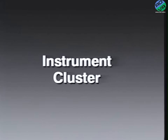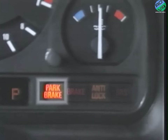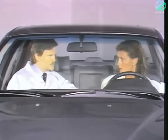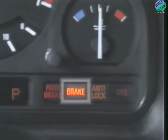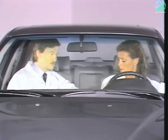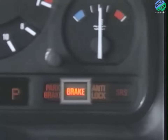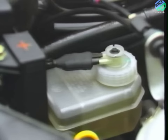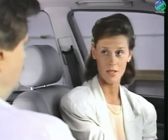These indicator lights are very important for any driver, Mrs. Kelly. I know this light comes on when I pull the parking brake. There's another brake indicator light that is tied to the braking and power steering systems to monitor hydraulic pressure. If that light comes on while you're driving, your fluid levels are probably low. If it flashes while you're driving, you've lost pressure in either the brake or the power steering system. The thing to do then is to pull over and check the fluid levels under the hood.